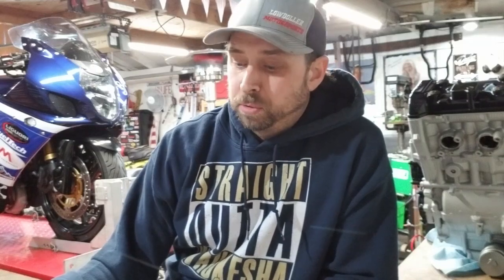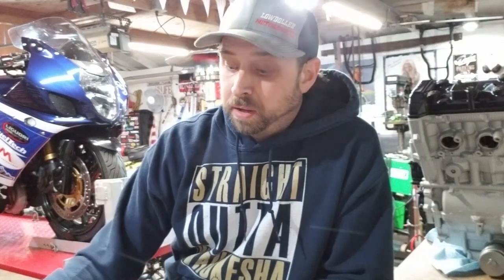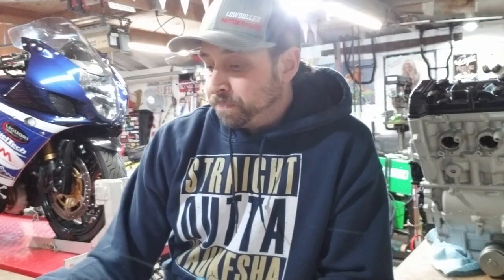I don't want to get into too much just dishing out advice because my brain works all different ways. If I was going to give anybody any advice on picking out a turbo, I would say err to the higher side on an AR number, because you'll outgrow a turbo with a small AR a whole lot faster. You'll outgrow that in a hurry compared to a higher AR, which you might not maximize, but it won't limit you. So that's kind of my thoughts on the turbo sizing and why I went with what I went with.